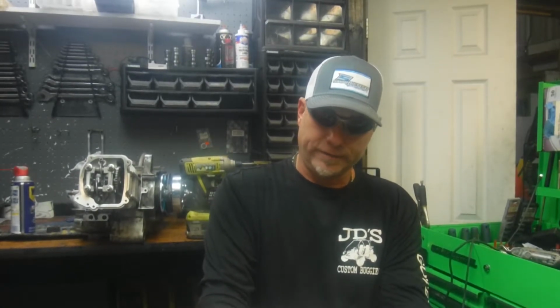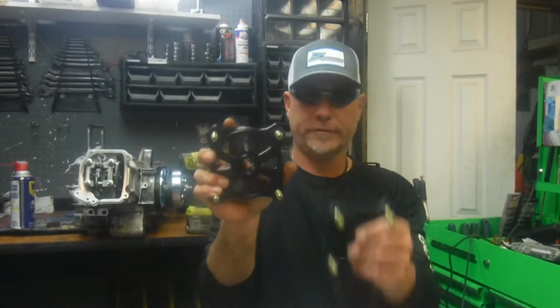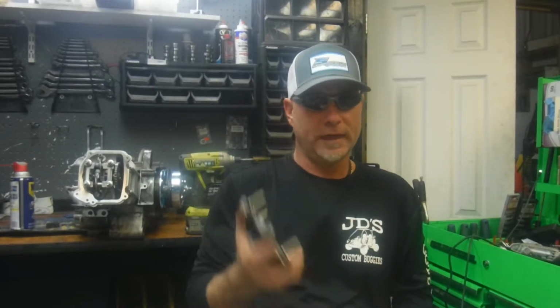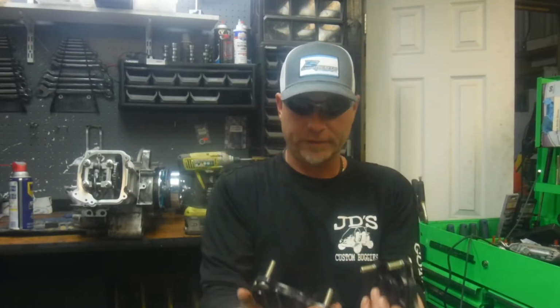And the reason for that is that 8-inch wheels can't take a larger lug pattern than that, basically. So as buggy manufacturers went up to a 10-inch wheel in the rear, they bumped up the lug size on the hub to 4 on 137. So, big difference. You're not going to find an 8-inch wheel that'll fit this one, but you will find a 10-inch wheel that will fit this, or an 8-inch wheel. So that's kind of the trade-off.